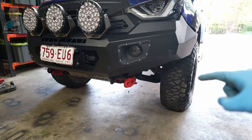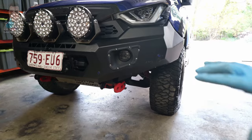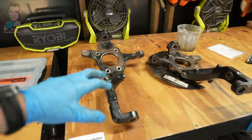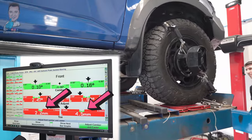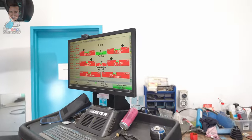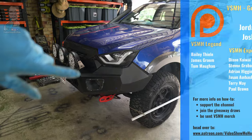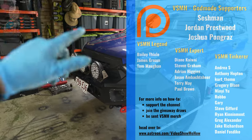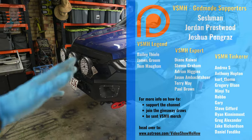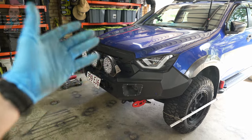Your final step is getting a full wheel alignment — that is mandatory because you need to reset the geometry. We have changed it, so you need that geometry to be spot on. And there you go, that is the full DIY install of the new Fulcrum steering knuckle kit replacing the factory units. If you haven't already, head over to the channel and check out the data-driven video that goes through all the ins and outs on the hoist before and after installing, so you can see how much of a difference it makes on the laser alignment machine. As always, a massive thank you to the patrons of Video Show Me How — head over to patreon.com/videoshowmehow. Hope you have an amazing day and I'll see you in the next video. Cheers guys.